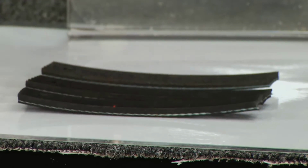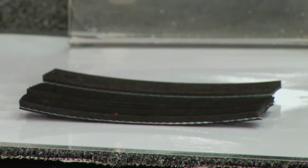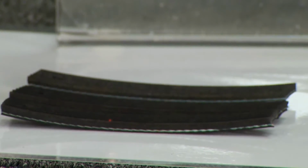Now the EPDM belts, there's a wear gauge, there's a way to check it. Can you demonstrate that? Absolutely. Today's belts wear a little bit differently. The old neoprene belts, as you were talking about before, they tend to crack, so it was easy to identify a worn belt. You look under a hood, and if it had 4 cracks between this 1-inch window, you replace the belt.